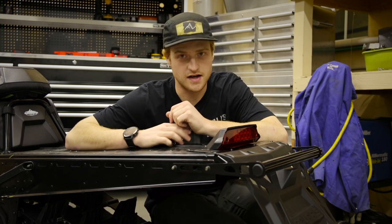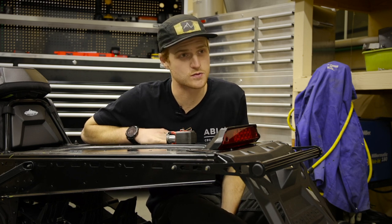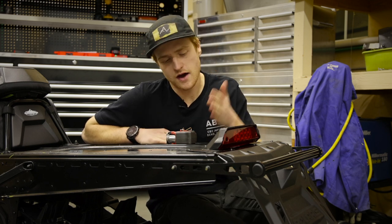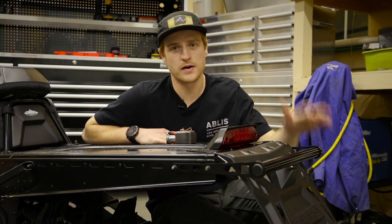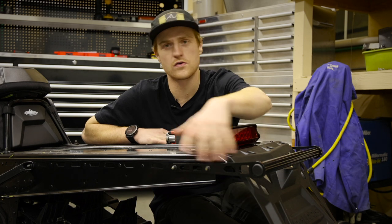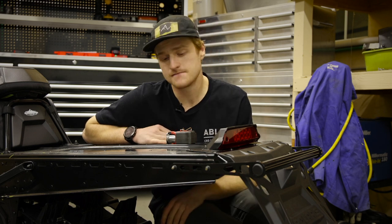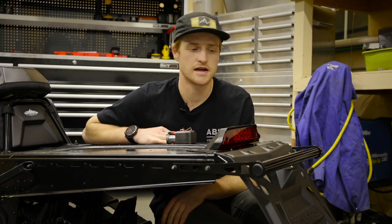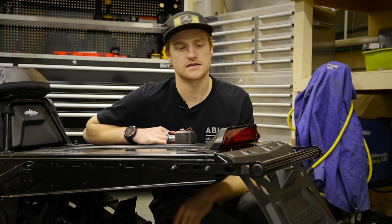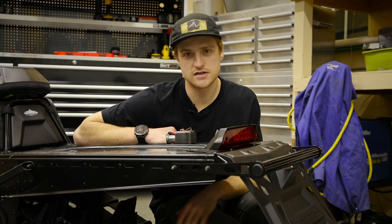Let's dive into it and talk about cut tunnels. Cutting your tunnel is a lot of work, but it is worth it in my opinion to shorten it up a little bit. It really does help — it gets that snowmobile out of the way back there. Your bumper no longer acts like a wheelie bar. It helps you maneuver in tight terrain. You really do feel the whole back of the snowmobile dragging in the snow in certain moves and certain terrain. There's a reason why all of us are doing it — even manufacturers like Ski-Doo are headed that way. With just a few simple tools, you can do this to your sled.